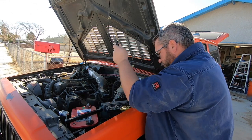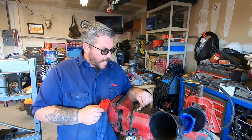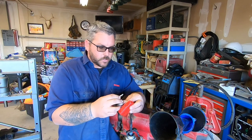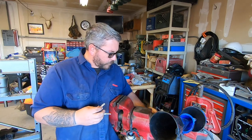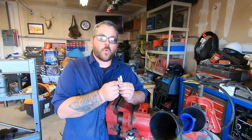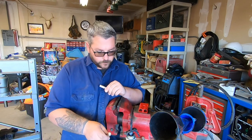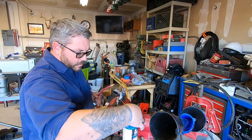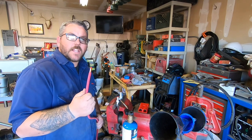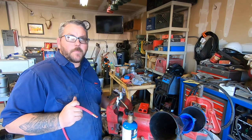In the kit with the plugs it'll come with a couple of these connectors. These connectors only go in one way, so make sure you put them in there the right way. I like solder, so I'm gonna solder these connectors. To keep it as clean as possible, I'm gonna wrap them in some tinfoil first. I'll get my torch going, heat up the connector, get a little heat on the wire, fill it with solder, push the wire down — easy peasy lemon squeezy.